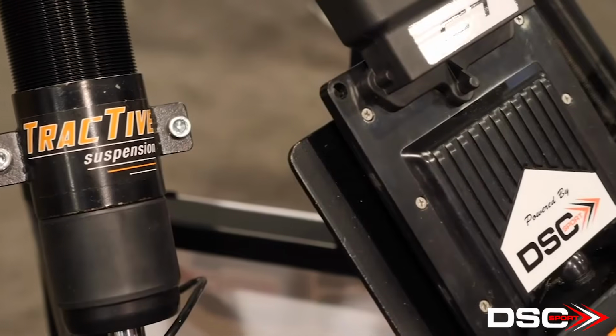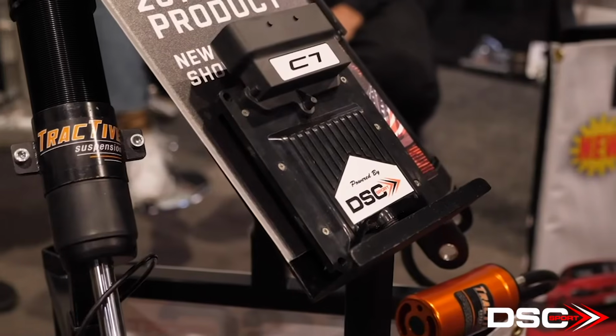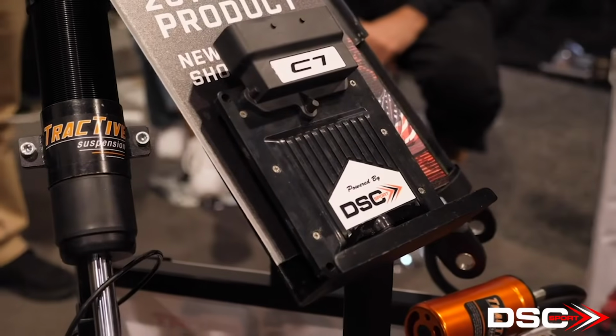All right, so just breaking that down into real simple terms, you're coming into a braking zone, you've got your suspension with bump and rebound dampening that's relatively compliant so that it's not skipping over bumps. When you hit the brakes, you end up with weight transfer towards the front of the car, so you stiffen the front suspension as a result to optimize the braking force. But if you were by chance on a very bumpy section, then you would actually soften it slightly to remain compliant over the bumps. Is that how I'm reading that? Yes, that's correct, because we're offsetting it, in other words.